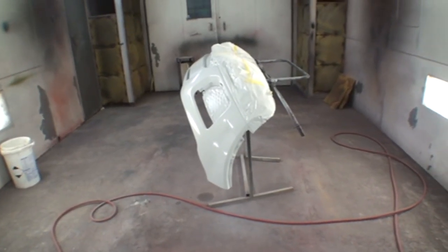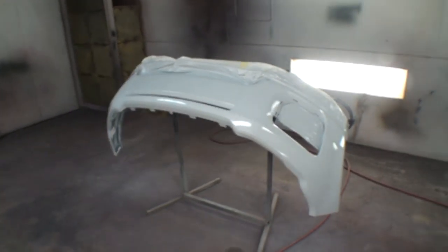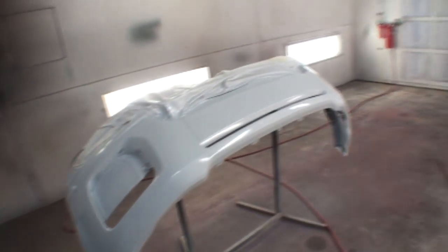We went ahead and applied both full wet coats of our quick clear. It's been on there about 15 minutes now. In about 35 to 40 minutes it's going to be dry and ready for installation. The good thing about quick clear when painting something like this is it dries so fast it doesn't have time to shrink, so it always holds a real high gloss retention. I was moving my hand and looking at the surface to make sure everywhere is fully covered with clear to give it that nice professional look. This bumper cover is now painted and ready for installation.